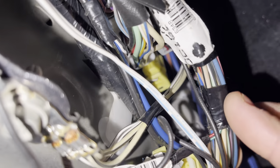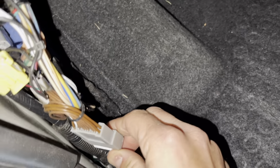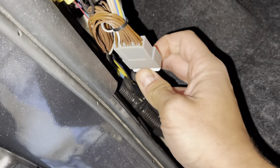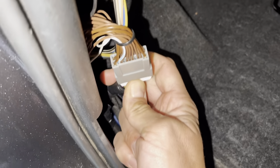You can see I've already run wiring to the doors, but the factory wiring is right here. If I follow that and look at these connectors, I can turn on my hazards or turn signal — whatever you want to do. You can do this with the car on or off: just unplug the connectors one at a time and see which one turns off your turn signals to your mirrors, then narrow it down to the connector you need.